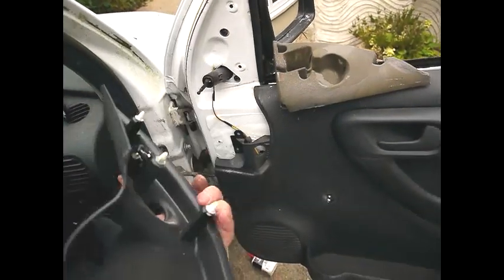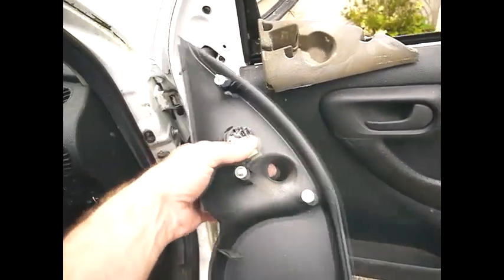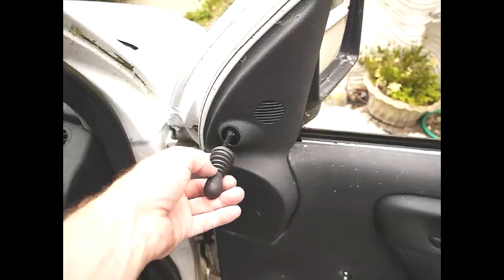This piece here has five white poppers, and there's a wire that has to go on. There's also a piece of anti-vibration foam that goes inside, so note where the wire goes before fitting. That item is buffed on with the back of your palm — it doesn't have any screws at all and just pushes on.